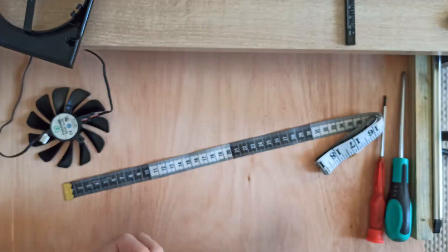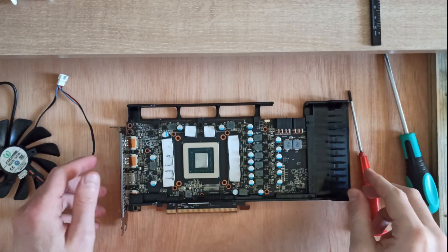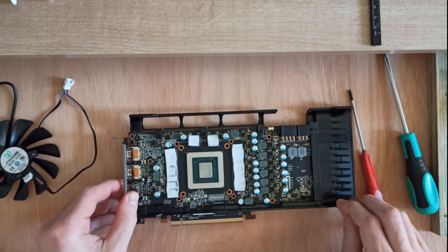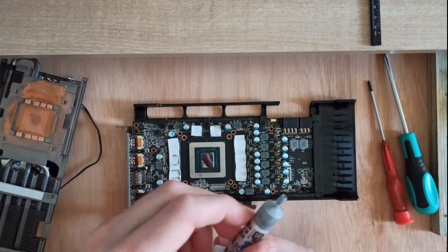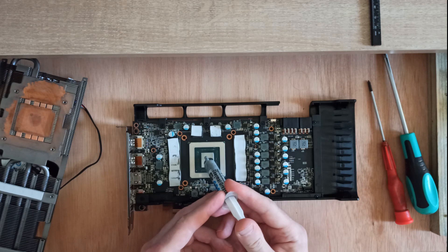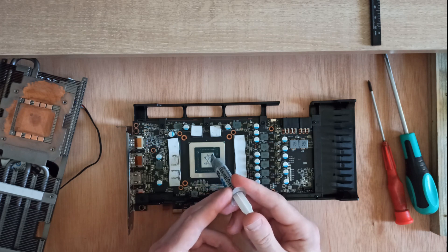Failing that, I have to cut the cable myself. The wiring isn't going to be bad on these — I can hear a rattling coming from a fan, it's the motor causing that. I can spin it by hand and hear it. Because I can't find a correct size fan replacement, an exact size, I'm going to have to cut somewhere. The chip bears no markings, but the perimeter bears the number 21509172200. I searched this on AliExpress and found that it's a stencil for 5700 XT reballing — that's what they're calling it. It could be the part number for the 5700 or 5700 XT; they both use Navi 10 chips.